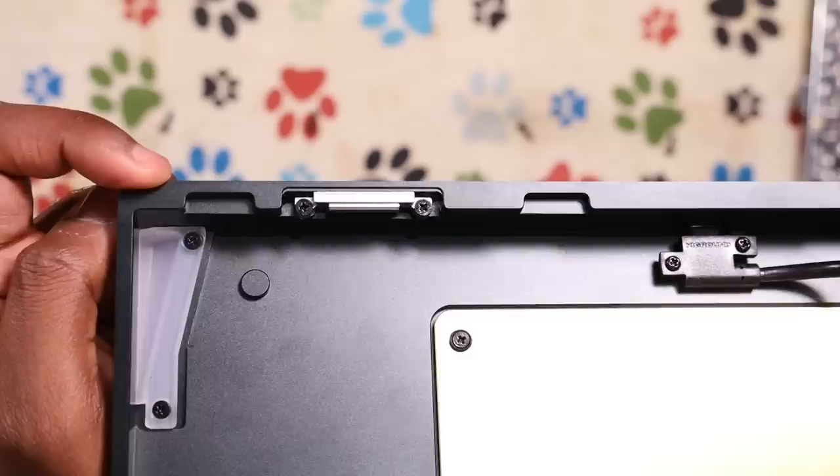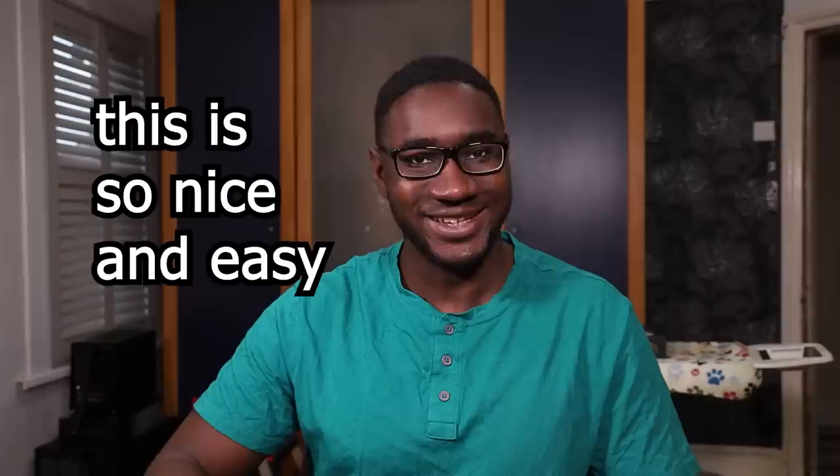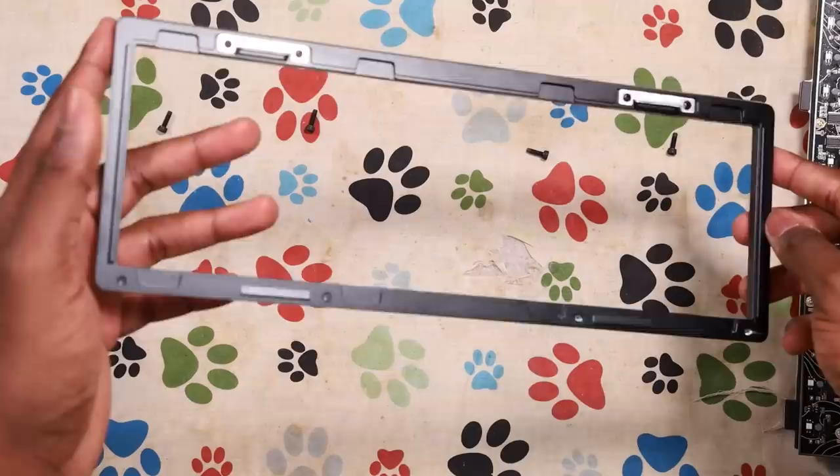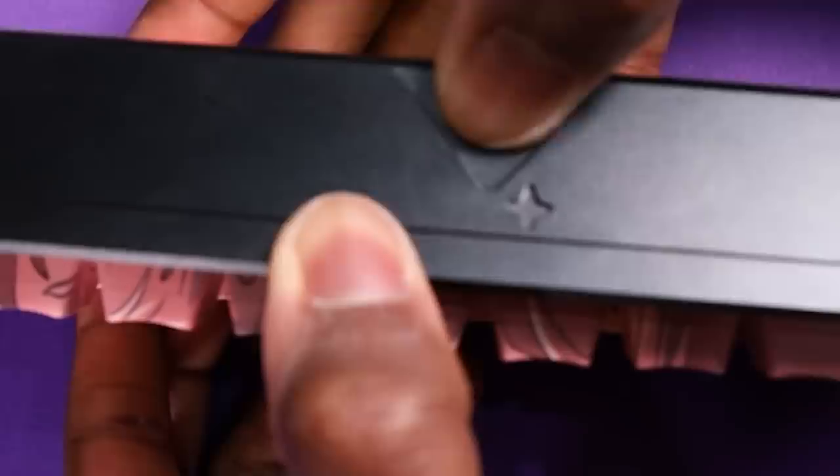On one hand it does make the case slightly easier to open, but on all the other hands — why? Having only four screws to undo saves you a minute out of your day, but are we seriously at the point where five screws is inhumane? And with these particular clips that have no way of tightening, locking, or screwing into anything, they've introduced much wider tolerances. It breaks the alignment pins in the top case, making any alignment redundant. Given there's no actual way of tightening the top side down, there's a pretty big difference in the amount of compression between the top and bottom case. I can literally pull the case about a millimeter open with my fingers.